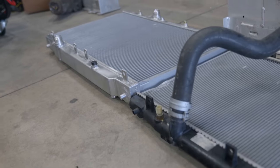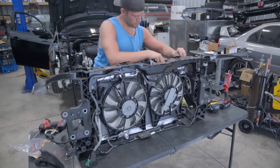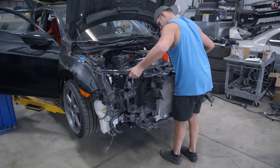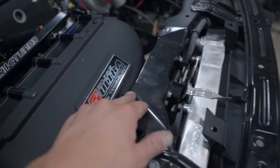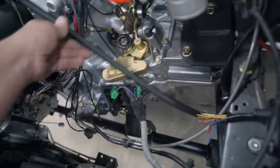Not only did we need the aluminum radiator for the bungs, but look how much bigger that radiator is compared to the factory one — it's like twice as thick. We should be able to run much cooler in this hot summer. For the first time ever, the entire front core support is on and we can finally look at clearance. I'm already seeing a little issue — should be easy resolution, either pull a spacer out or leave a spacer in. Now let's go ahead and build our radiator hoses.